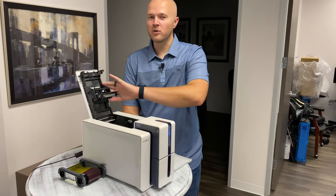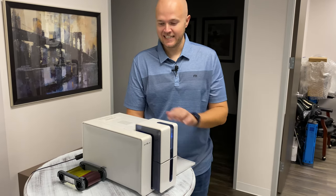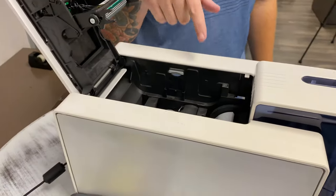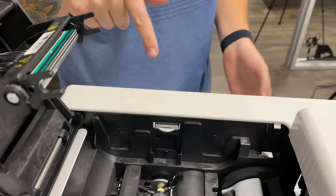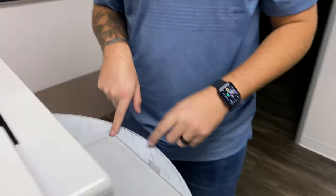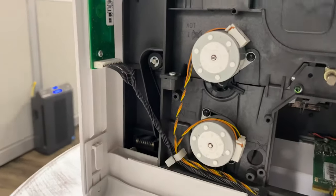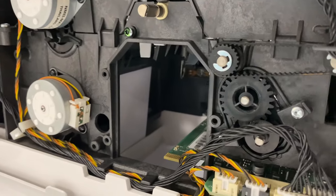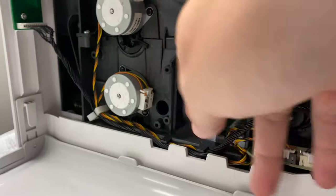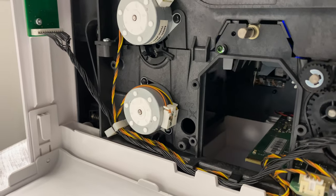Has your printer ever made this horrible noise? Yikes, that's not good. What we want to do to fix that sound — there's a card jammed in the very front of your printer. If you come right here and look inside, it's underneath this flipper. The way we're going to access underneath the printer is this little gray tab — pull that up and this little side door opens right up. There's a little hole right here on the side, and as you can see in there, there's a card jammed towards the very front of the printer. All we're going to do is reach right in here and pull that card right out. When we close the lid again, we should be back up and running. Much better.